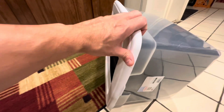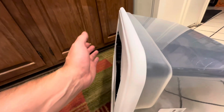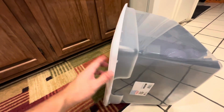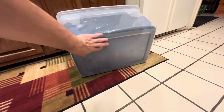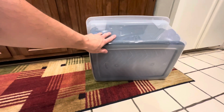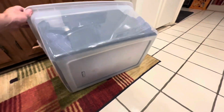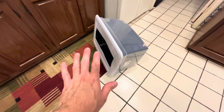You could try to deaden the sound, but the fact that your tips are only going to come to here, it's going to work a little bit, but not what you're thinking. So even when I went with the valves closed, it's basically the equivalent of just putting something in front of your exhaust tips. And so that's what was quieting it down. It didn't really quiet it down the way you would think a sound chamber would. So it's got to work together.